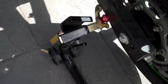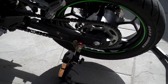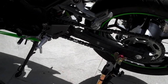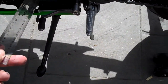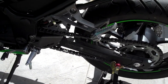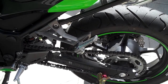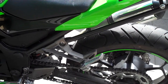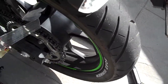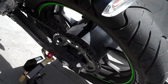Hey guys, I made a post the other day — one of the guys in the forum was talking about sprockets and chains and stuff, and they suddenly get some pretty loud clicks from down the front. I'm not sure if the dealer did the install or not, but long and short of it, I said on the post: what you need to do is check to make sure that your rear sprocket and your front sprocket are in line, and the easiest way to check that is with the chain.